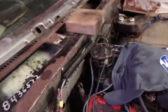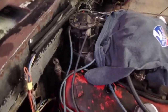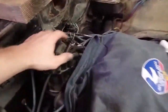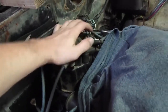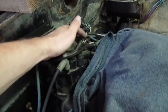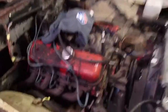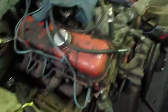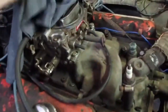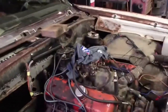All we got for ignition right now is a stock HEI and some worn-out plug wires. They're all busted up and were arcing across each other at the races, causing a little bit of a misfire — so that definitely needs to be addressed. Our fuel system is nothing more than a stock fuel pump and an old Edelbrock carburetor, so I know we ain't getting peak performance out of that.